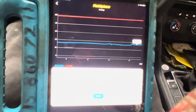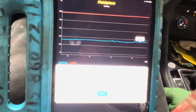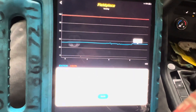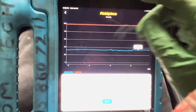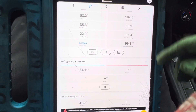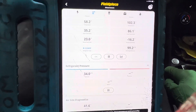For the old guys who like to whack off the cans and keep shoving them in there until they get a certain pressure — this is why I see so many dead, burnt-up compressors, cracked shafts, or slipping clutches. Because the guys who go and get the cans, they don't weigh it in, they don't do a vacuum, they just guess. They're looking for a pressure on their gauge, and you can rev up the car all you want, but unless you've got an extra pound in there, you're not going to get that pressure you want. It'll start seizing up the compressor with liquid refrigerant. See you guys later.